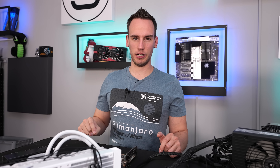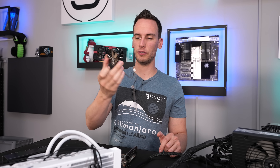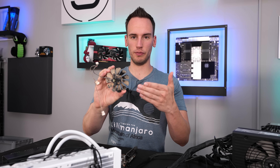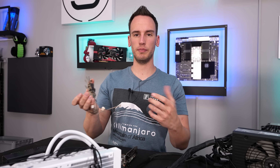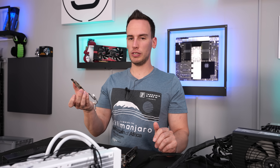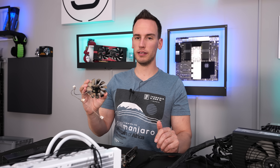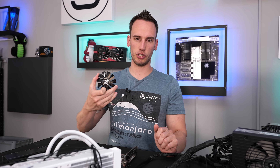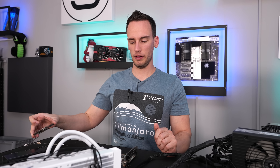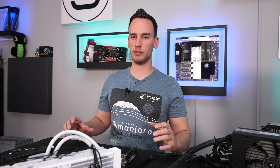The issue with this card was that when we took it apart completely, we figured out that some of those fans — if there's water and mud inside the bearing, you would have to take it apart and clean everything and re-grease them. But that didn't work out. We broke the fans because they're not meant to be taken apart. I read some of your comments — thank you for leaving those — that we shouldn't rely on replacing original fans and can just do a fan mod.